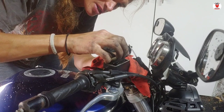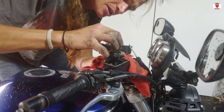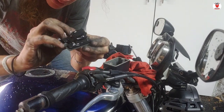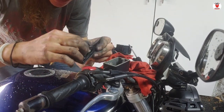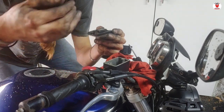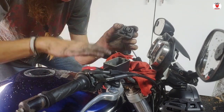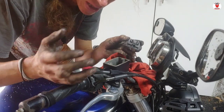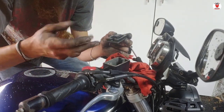This normally comes with two parts: the first is this little cap, and the second is this little rubber thing. You'll notice this rubber protrudes quite a bit. It's actually designed like that on purpose so that as you use fluid, it closes the size of the chamber over here, basically reducing it so that it uses less volume.